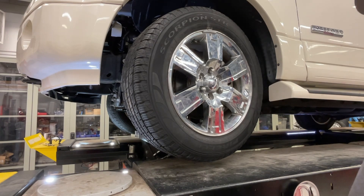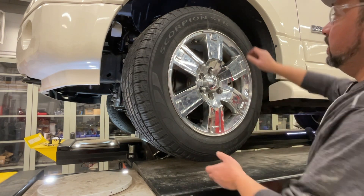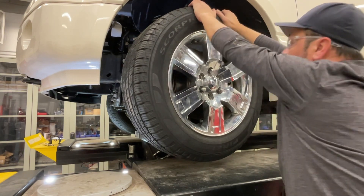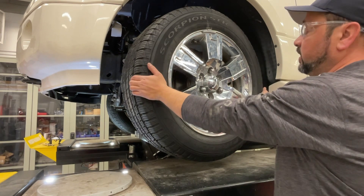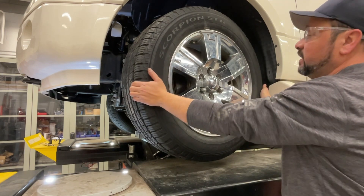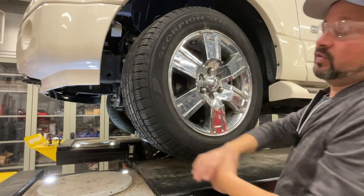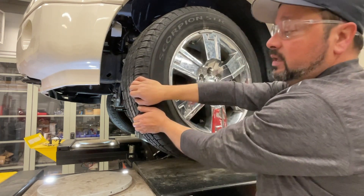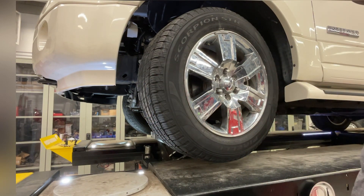Just to give viewers an example of what it would look like if you had ball joint play — this could also pertain to wheel bearing play. When you grab the wheel and shake it, there's going to be movement, and then we need someone to determine where the movement is coming from. This check also works well to check steering components. I'm simulating it now — the wheel is loose but you get the idea: you will hear a knocking noise. This also applies to checking follower ball joints at the bottom if you have a different type of suspension system like McPherson strut. Shaking the wheel will give an indication that something is loose, and we would need someone on the other side to check it and tell us what it is. Thank you everybody, we'll see you next time.